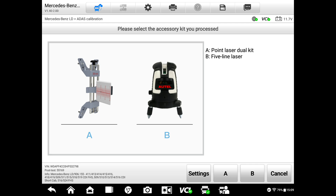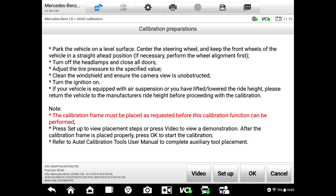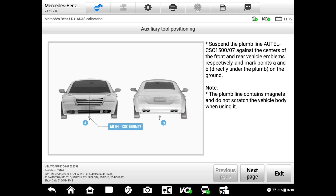It's asking what we're going to use for this setup. We are going to use B — that's the five-line laser — and the target we have matched up is the CSC-0601-19, so that's on B, and we've got our plumb-line laser and tape measure. The setup routine asks us to establish a center line on the vehicle. Our first step is to mark out the spot in front of the vehicle so we can place our target.